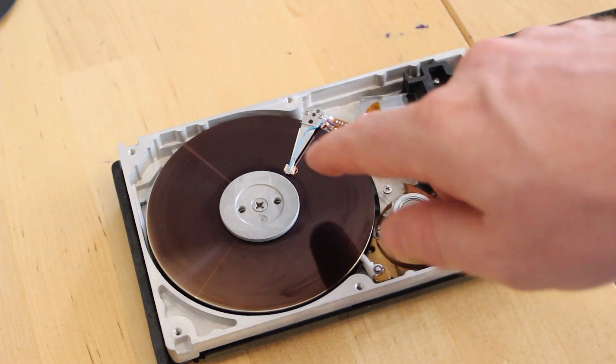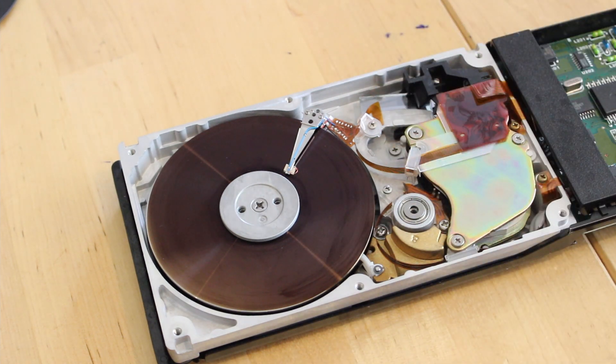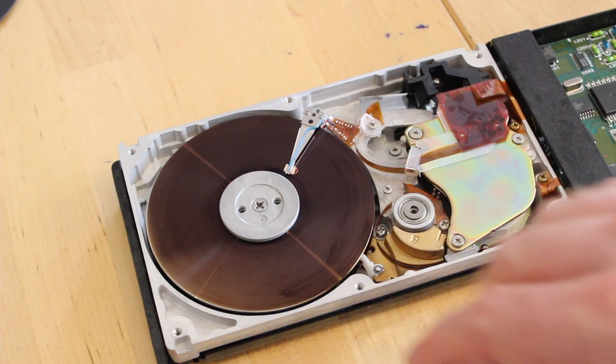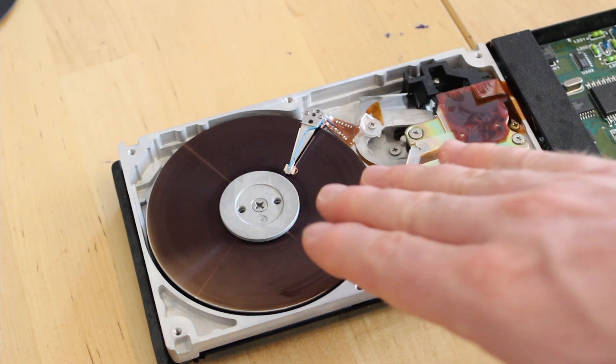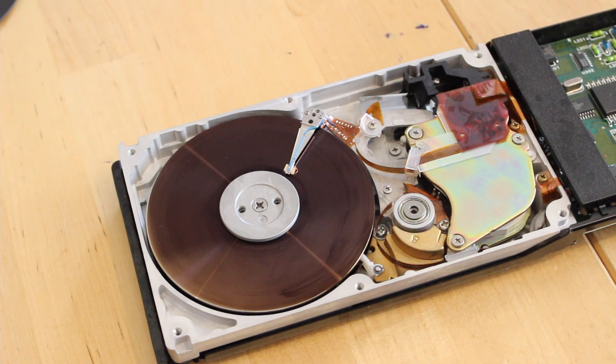Once you take those platters out, you're going to have some problems with alignment when you put them back in. First of all, this metal hub in the middle needs to be exactly centered — if not, it'll wobble and it cannot read the disc at all. So you do a lot of fiddling to get this back in the exact center. The other problem is that the platters need to be aligned with respect to one another in the rotational direction, and this is not something you're going to be able to do by hand. I'm hopeful that I can low-level format this drive to get the track information back on so that it's reading both tracks simultaneously in the same orientation. There is some software that came with these drives that I can try out — but failing that, this drive may be balked for good.